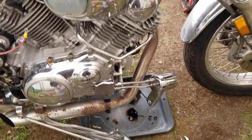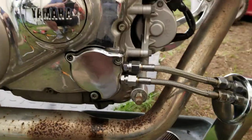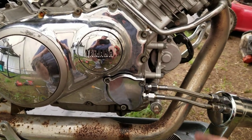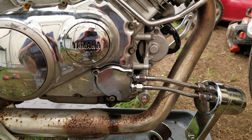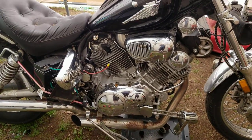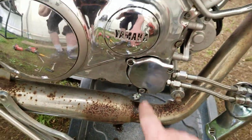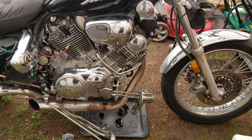I had it running a few minutes ago and there's a small leak at the fitting — no sealant on the threads yet, you can actually see it leaking down right here. That's okay because those fittings are coming off and I need to get angle fittings to position everything properly. To end the video: one more modification I should mention — the bottom bolt hole in the housing I had to drill out to 5/16ths because of the shank where it passes through.